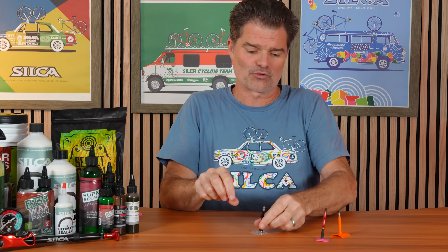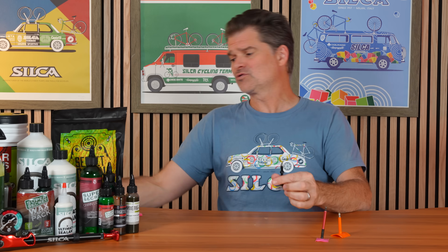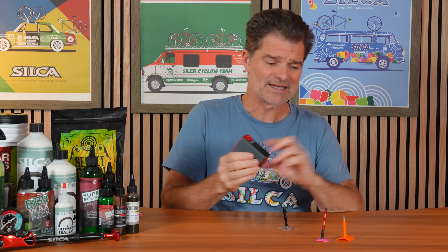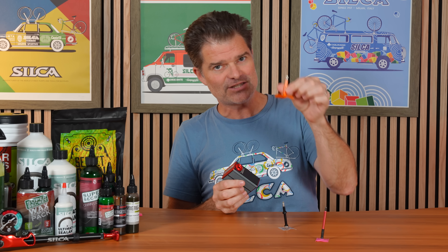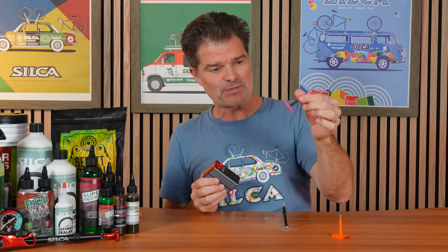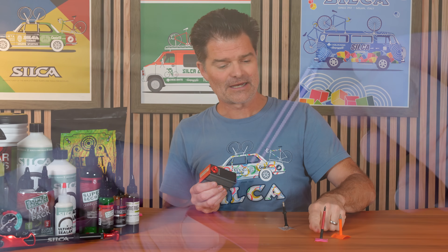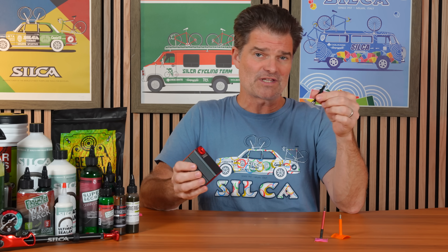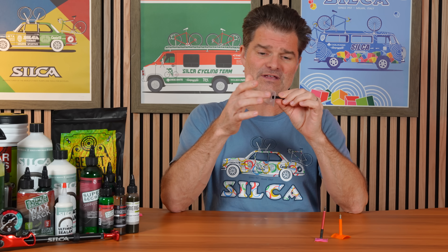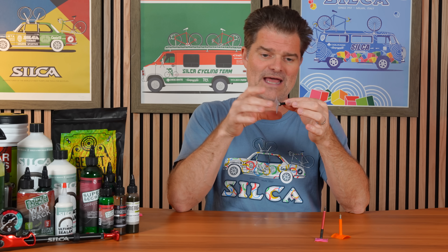It's all held in the valve stem, which is now sandwiching the rim. This full construction also allows you to use electric inflators, which all the other brands say you can't — because they are essentially just force-threading the Presta valve core into a piece of plastic, and the heat from electric pumps will cause that interface to fail. Even the ones with a half aluminum, half plastic valve stem can fail at the base from heat. What we recommend is filling up in about 15 psi increments, giving it a break, then going back — if you go slowly, you will not fail the TPU at the bottom.